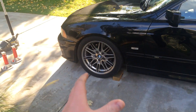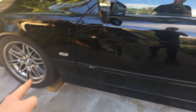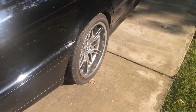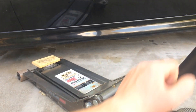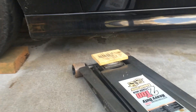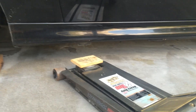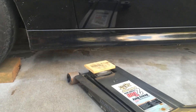I have these wheel chocks in place for lifting the rear of the vehicle right now, so this does not apply. If I were lifting this corner of the vehicle, I would put one brick in front of this tire and one brick behind it. When you prepare to lift the vehicle, position your jack into place in front of the jack stand. I use a piece of wood to minimize damage to the jack pad — you don't have to, but I highly recommend doing so.